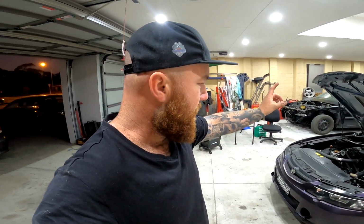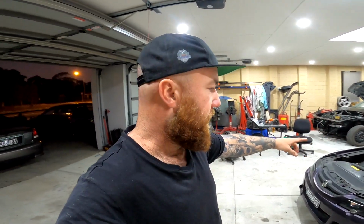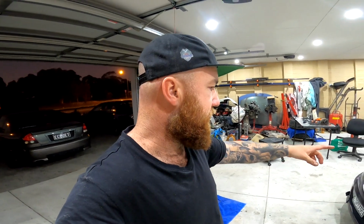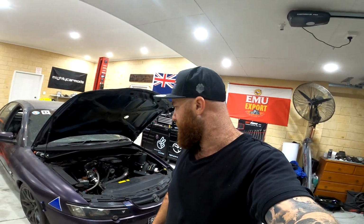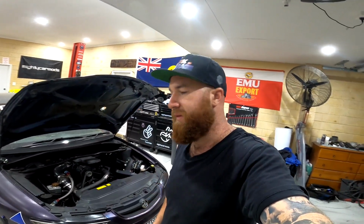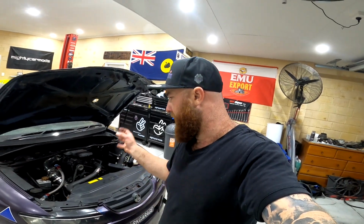At the moment the oil filter is leaking. It doesn't use a normal Commodore one. The timing cover I use I got off the firing motor, which came off Gun 38T, and he has adapted it to a different thread. I'm guessing maybe I didn't screw it in enough, so it's leaking out the bottom. I need to do an oil change anyway because the water got in there. So I'll do all that tomorrow, get that filter off, new one on.